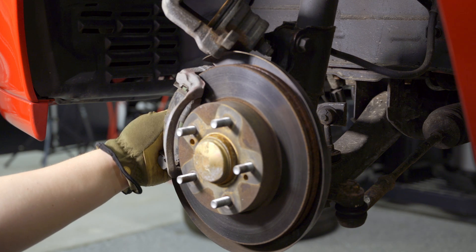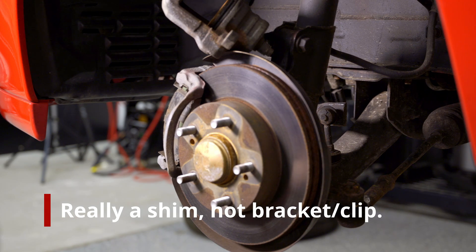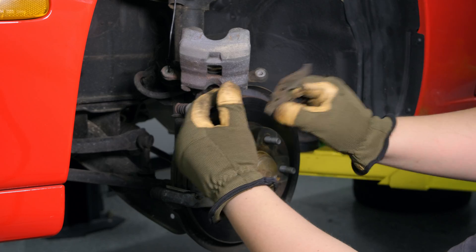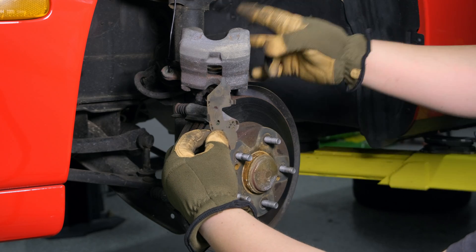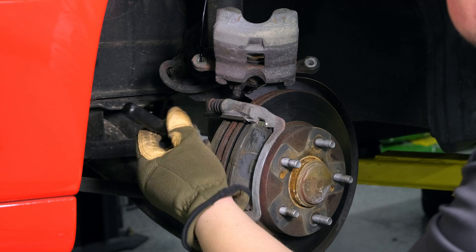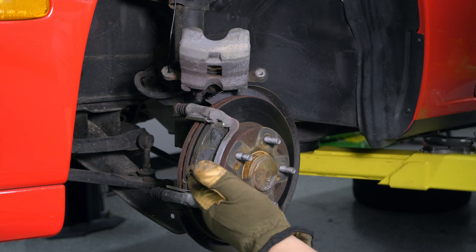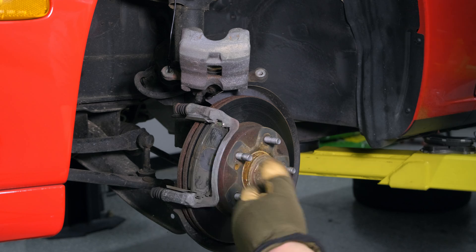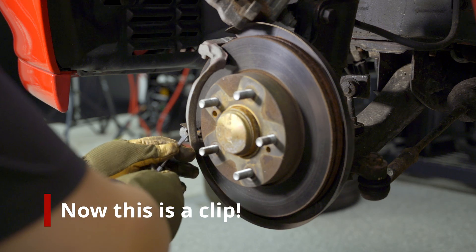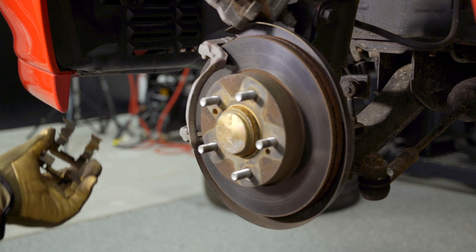At this point we can start taking some of this equipment apart. In the back here is a little bracket — I'm going to save that. This one sits in front of the other and it actually sits between the pad and the clip that sits in front of the piston, so it's kind of two plates — pretty interesting design. This is where a little screwdriver or pry bar can come in handy. We got this pad out and it does look to be a Nissan OEM pad, actually still in pretty good shape but very dusty. We pick up the clips and we are ready for new pads.